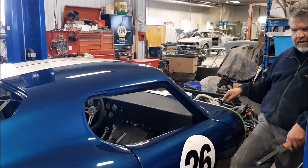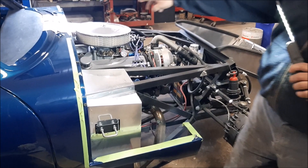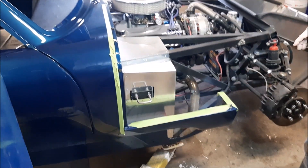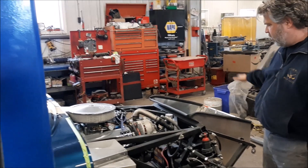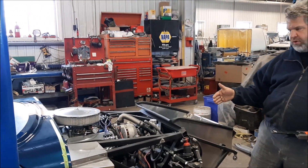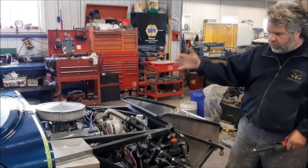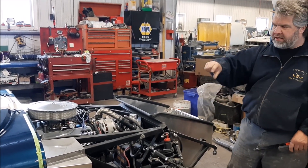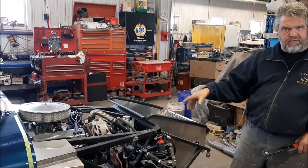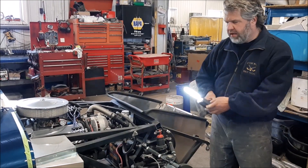You can see we've got some masking tape. We have our bumpers installed and our pins installed, because they did some dry fitting once again with the hood. We've had the hood or front nose on and off this car roughly six times to make sure the fit is correct. They do minor adjustments and some more sanding on the edging. Then just before it goes to paint, we fit it one more time, clamp everything down, make sure the alignment is correct and the gaps are right. So that's the stage it's at now — the next video will share the hood and all of the work that we've done with that.